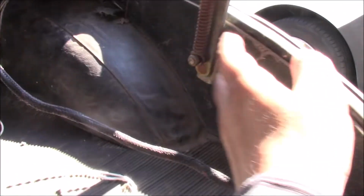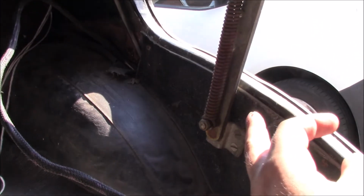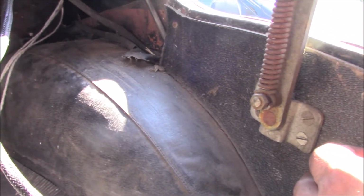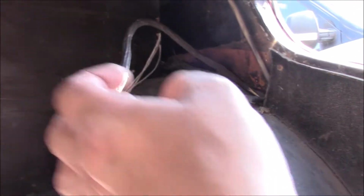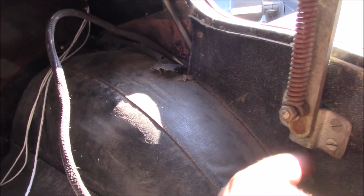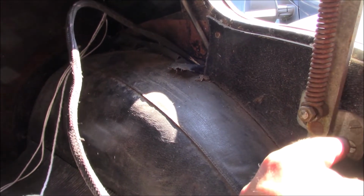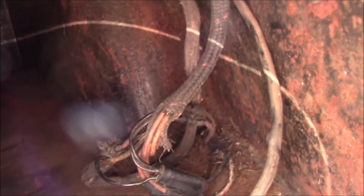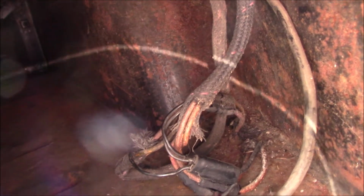Right, next section. I've had a drink and a mini rest. I've got to unscrew this panel here and this hinge, all little flathead screws, so that I can get this section of the wiring out. I can feel that something is catching in the middle, so it's probably another hole through the frame that they've threaded it through. Once you've got that section fed through, you can then get in the underboot bit, and you can see that's where things start branching off for the rear lights.